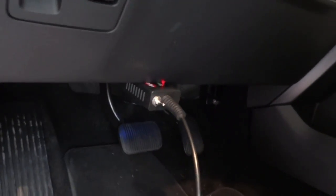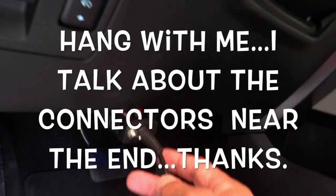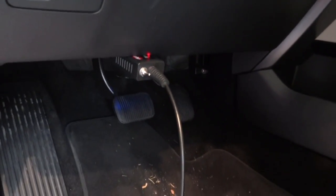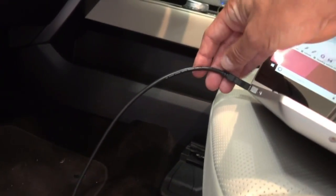When you hook up your computer to your vehicle, you're going to want to buy one of these. There's all kinds of links and ideas and ways you can configure, but you need to get a connection to your OBD port. I'm using a hardwire connection. This is very reliable, works really well.